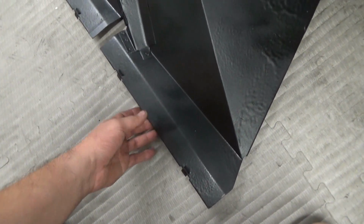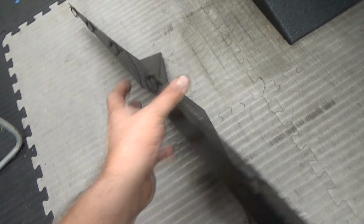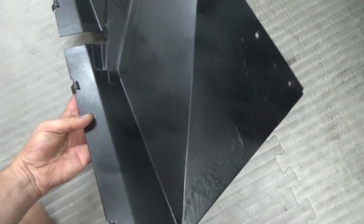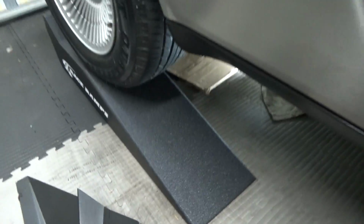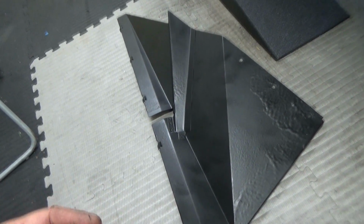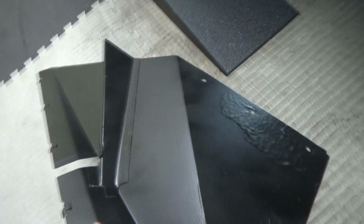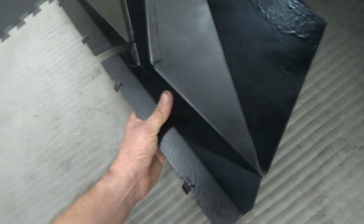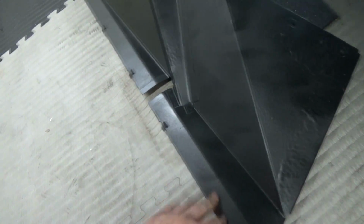So I took the liberty of refinishing the air deflector plates. I didn't spend a whole lot of time doing that. All I did was clean them as best as I could, and then I plasti dipped them, and then I used the satinizer on them, and then I used dip coat. I felt like it sort of mimics the look underneath, because with these late model cars, what they had done in Belfast is they sprayed this kind of rubberized undercoating on some of the metal parts in order to protect them from corrosion while they were sitting on the dock. So I thought that kind of helps blend it in a little bit.